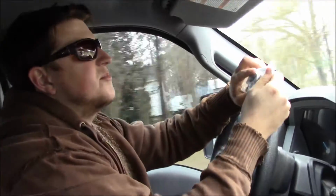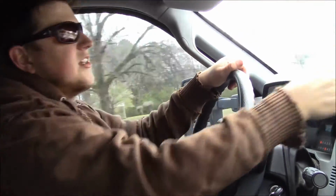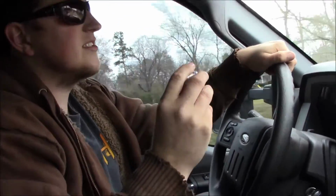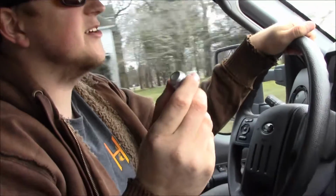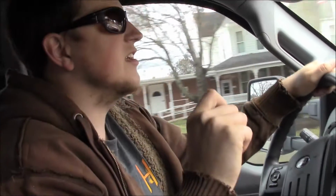All right, on the turbo side, we got a flange. It's gonna bolt up with our AN fittings that came in the kit with the line. But on our oil pan side, I had my friend gonna weld it up, and I was like, hey, just weld this on real quick. And he was like, well, we got a problem because this is aluminum, and my oil pan is definitely steel, so that's not gonna work. He said it's not possible to weld that. So we're gonna go and buy a barbed fitting that's steel, so we can weld that onto the steel oil pan, and we'll just slide the hose over and put a hose clamp on it and keep on rolling.